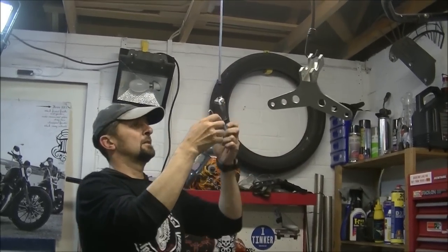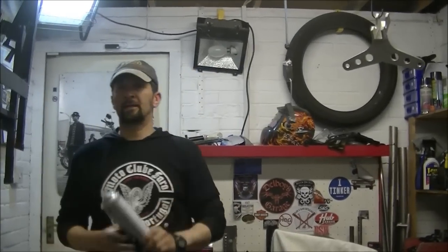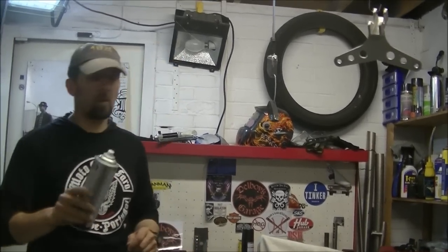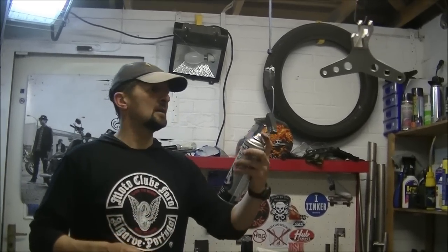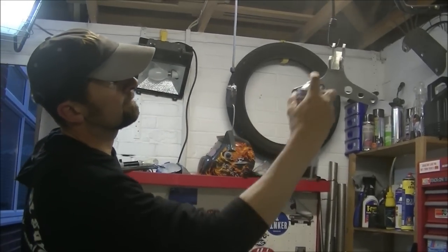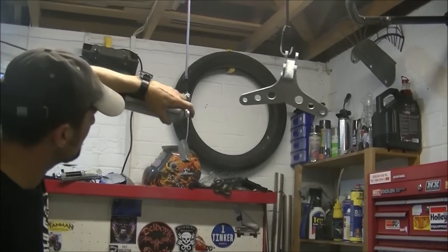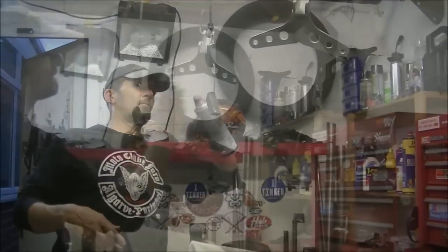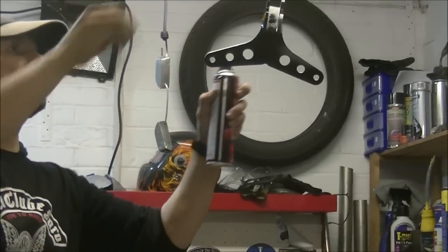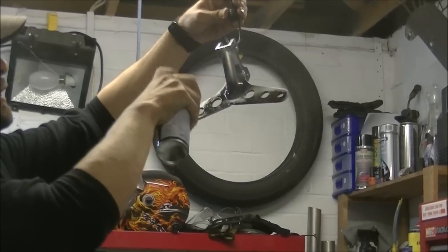Okay, ready for paintage. Here we go. Now I've said this before — wheel paint. Wheel paint is like primer somehow. It goes on bare metal without any primer and it stays on. So I've got a can — I've got loads of it — I'll just use that for primer. Just a light touch over it, just to make a tack coat ready for the black. Now this is just a coat of paint for now. I'm not going to worry about the whole scrim thing — swadging. I'm not going to do any swadging on this. It's just a bracket, so it's just getting painted.